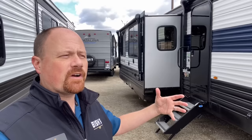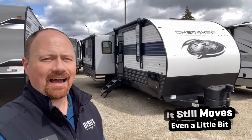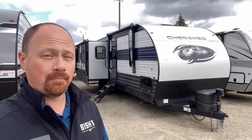Here's why: that slide box's position in three-dimensional space is relative to the body of the main cabin of the RV. I get that you've got jacks, stabilizers, auto-leveling, and cement blocks under the thing — but as you move around the RV, kids move around, or the wind rocks it, the body will move. If you've isolated the slide-out so it can't move and the body of the RV shifts at all, you're breaking the seals and potentially stressing all the hardware, fasteners, and systems. And if the ground settles even slightly but the slide box can't move with the RV, you no longer have a fully extended slide — you have a broken seal and a problem. I do not think you should ever use slide jack stands, and keep in mind I'm saying that as someone who could make money by selling them.